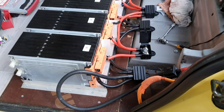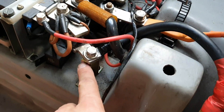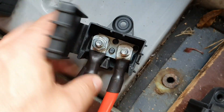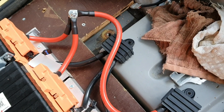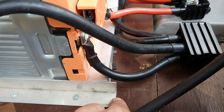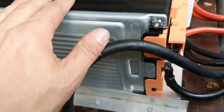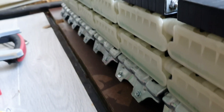I've wired everything up in the way I had to do in the end. The negative is on here connecting up to the negative on the battery terminal, running through here, and the whole string is wired in parallel. These little junction boxes are quite cool because you can wire everything in and screw it down firmly — everything is wired in parallel using some pretty large wiring that's going to cope with the amps. On the back I've used 25 by 25 millimetre angle aluminium from B&Q, screwed down on the side to hold the batteries in place, with a piece going over a lip on the back of the battery, and the original clamps to screw it down along the other side.